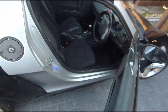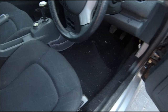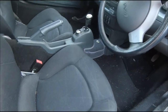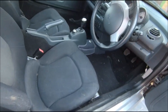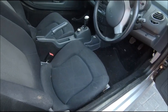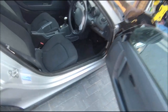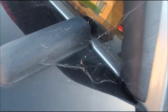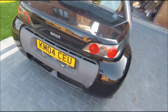I think maybe we'll leave it for tonight — everything seems to be working okay. The brakes are a bit rusty, they've got to come around yet, but I can sort those out. A little bit of tidying up inside. I think there's a good oil change needed because there were a couple of little flashes from the oil light, and smelling the oil it seems to have a bit of petrol in it. Looking to get the filter and oil for that, and then a really good clean because yeah, she's looking a little bit cobwebby and dirty, but I think it will clean up okay.